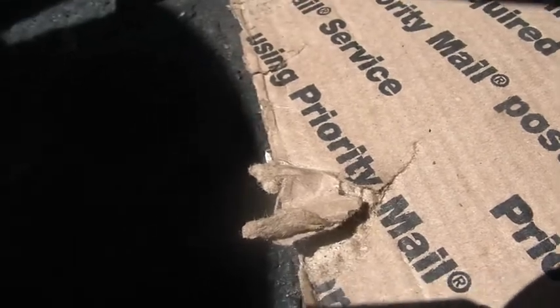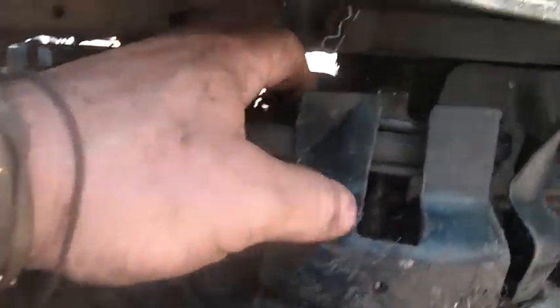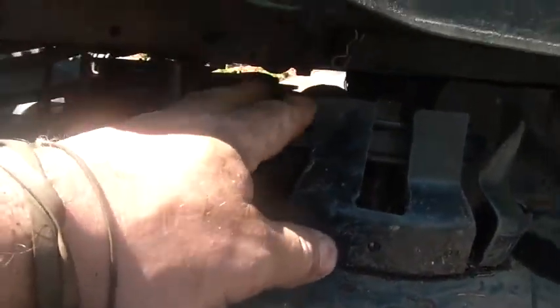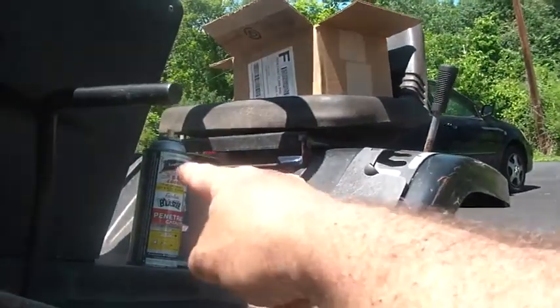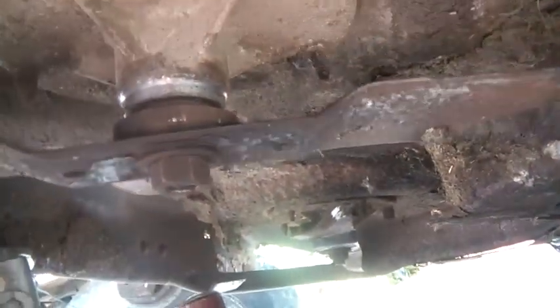problems with the blades. I rebuilt the spindle assembly on the other side, and I went to cut grass, and this side started to act up. So, you do the normal troubleshooting. I did the normal troubleshooting, and the pulley wasn't stripped, which was all good. So I got underneath it, and I put a spoon wrench on the bolt up here. Then I used my PB Blaster on the bolt down here, and I got underneath, and it turns out that the blade was loose on the shaft.